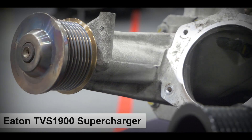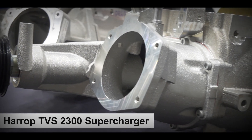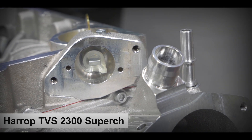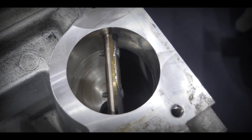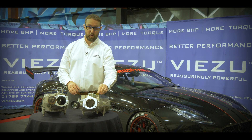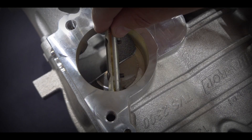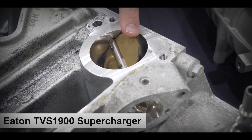Looking at the front of the Charger, we'll see subtle differences in the machining — just optimising the fitment of components. Remember, this is a direct fit replacement for the original 1900 Eaton Supercharger on your Jaguar Land Rover 5-litre Supercharged engine. We've got the electronically controlled Supercharger bypass valve, same as on the standard vehicle, with an adapter fixing to ensure perfect placement. A really big positive of the Harrop TVS 2300 is that there's a mechanical stop for this valve machined into the top of the Supercharger, preventing any erroneous movement on the electronic actuator from accidentally opening it too far and the valve getting stuck open — a good safety feature. On the standard one, it can move freely past that stoppage point.